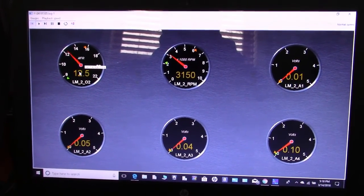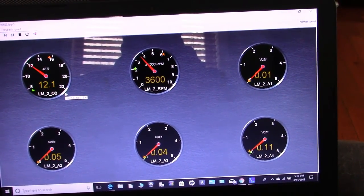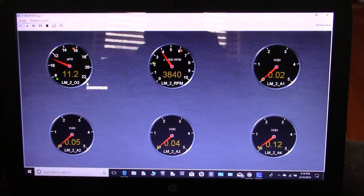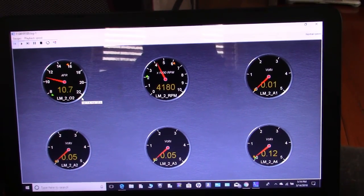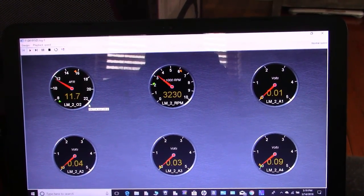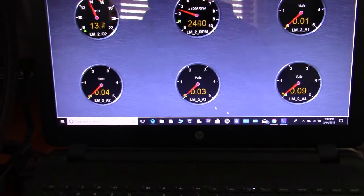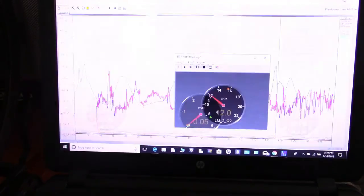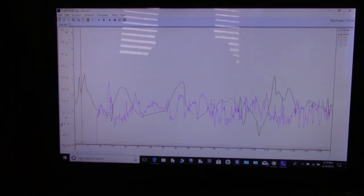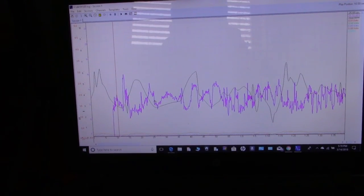It worked and pulled RPM — I was keeping an eye on the gauge, so it looked like 12 to 12.5 down low and then in the mid it was 12.6 to 13.4. That's okay. It was very cold out — 40 degrees — so it's likely going to run a little richer when it heats up. I think everything will settle around 12 to 12.6. When I pop race fuel in there it will probably end up around 13 to 13.2, which is pretty much ideal for the ZX7 based on my past dyno experience. You can use this thing to play it back.